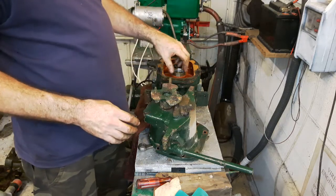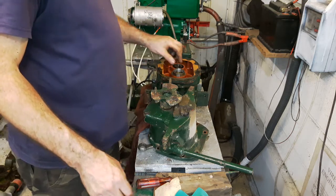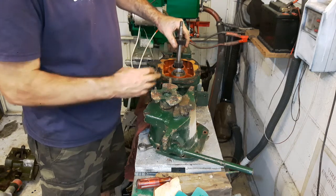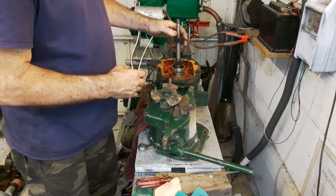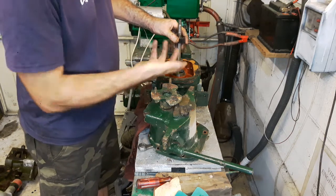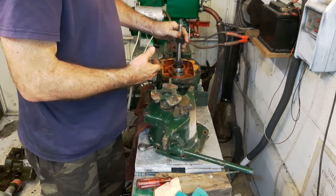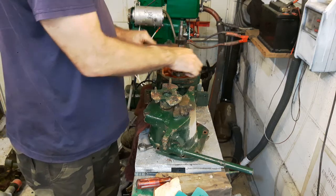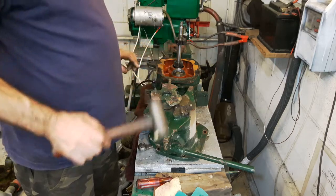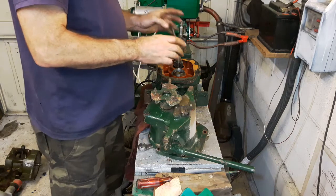Then push it all down. If you've taken this out, you need to tap that gently in with a soft-face hammer or a piece of wood between. Make sure that's firm. When you are putting the gearbox on, make sure that the dog in the pump shaft lines up with the crankshaft dog, otherwise it won't go in. The way you do that is get it roughly lined up by eye first, then to get it precisely lined up, jiggle the flywheel around by hand until you feel it plop down. Once it's engaged and the two dowels are clear of the gasket, bash it down on these two ears until it's flat. Then start with the peripheral bolts, remembering the two underneath.